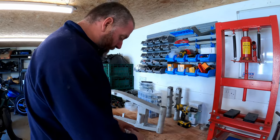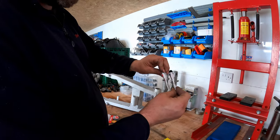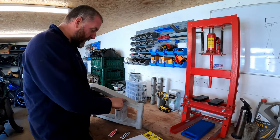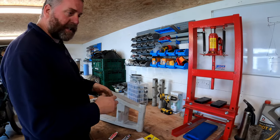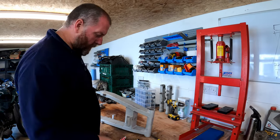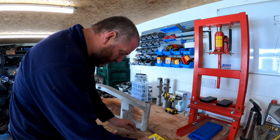Right, what we want to do is mix some of this. I'm going to mix it in small quantities. I'm fairly confident, I mean, these aren't full. That's probably enough to do the job that we want to do, though. I'm going to mix it in very small quantities, and then just apply it in small layers. And then obviously I'll let it set, build it up, and then at the end I can just rub it back, and hopefully it'll leave a nice smooth finish ready for the powder coat, and it'll all be good. So I'll start off with a small amount to start with,